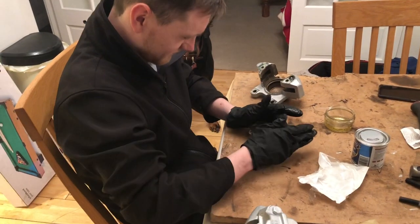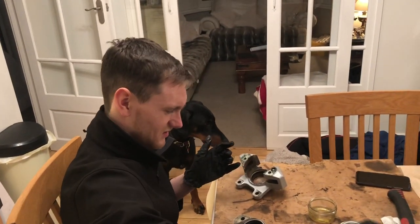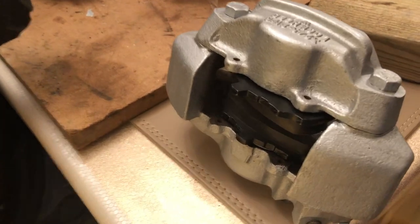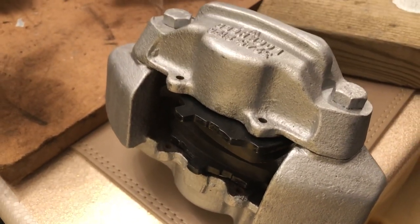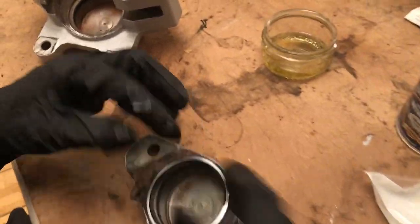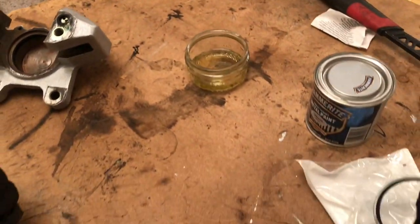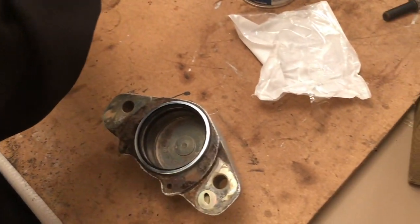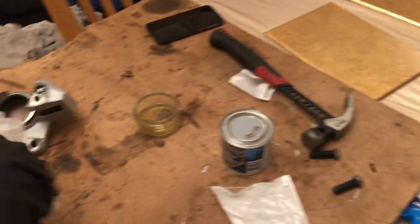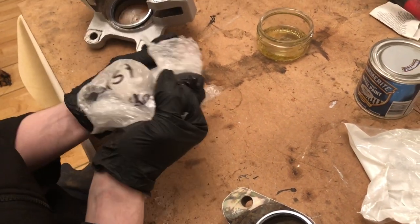Here's Harry himself rebuilding these brake calipers off the Stag. Here's one he finished earlier, which some of you may have seen a photograph of — looking nice and clean. Coming around over his shoulder, what he's done is split the caliper into two: here's one half and here's the other. We're putting in new seals, new pistons, and new nipples.